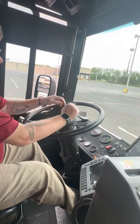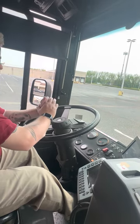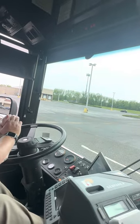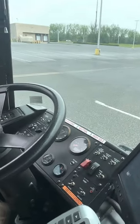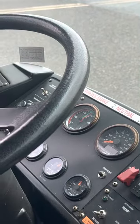Minute's up. I didn't lose three pounds of pressure. I'm going to fan my service brake until my low warning light comes on. On this particular bus, the low warning light came on at 85 pounds of pressure. I'm going to continue fanning until my spring brake pops.